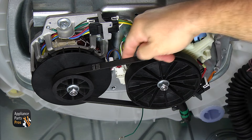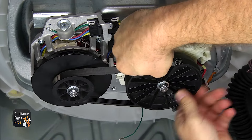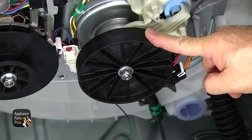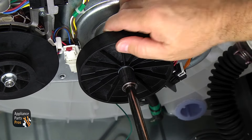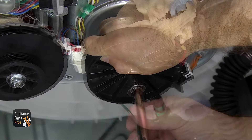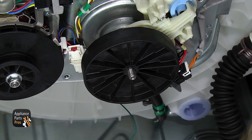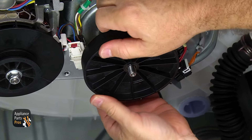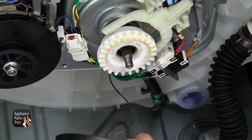Then we can take the belt off. We just have to pull down on it while we turn it and pull it off the pulleys. Make sure you don't catch your finger between the belt and the pulleys. Once you have the belt off, we're going to take off the pulley on the transmission using the 9/16 inch socket with a ratchet and extension. If it's not on there that tight, just make sure you hold it while you loosen it up. Once you have the nut off, the pulley is a little tight on the shaft, so grab on it and wiggle it, pull it down. Once you have it off, set that aside.